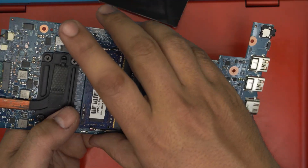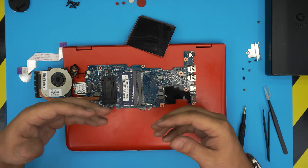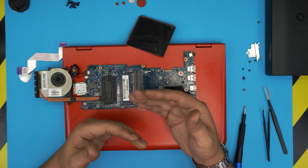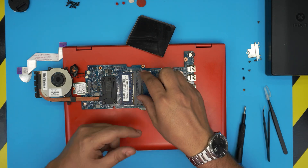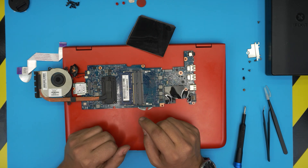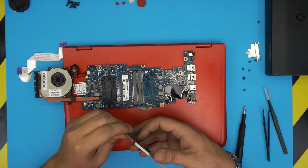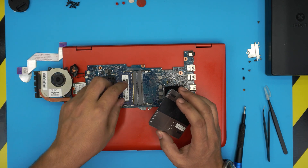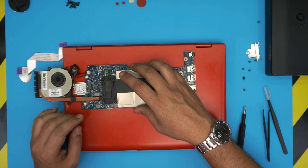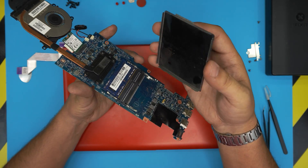Here's an important tip: if you upgrade the RAM and the laptop turns on but there's no display on screen, you need to open it back up and swap the RAM sticks between the two slots so the BIOS can detect them properly. Turn it off, swap the slots, turn it back on, and wait five to ten seconds for the BIOS to detect the RAM — then you should be good to go.